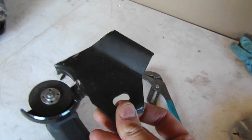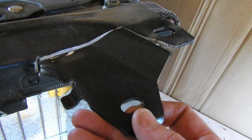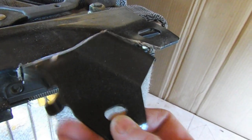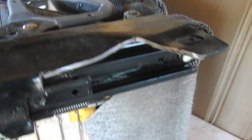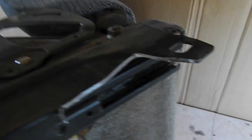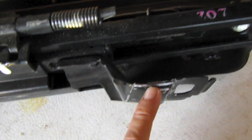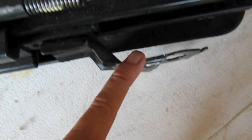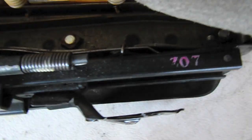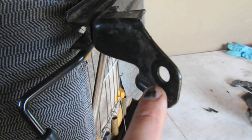Using an angle grinder, I ground off this bracket here. If we come over to the seat we can see where it came off. What I've done is bent this side up so it's a little more in line — a little straighter with the rail — because usually it bends downward at an angle. On the rear right side of the seat, I actually cut some of the bracketry and leveled it out so it's lined up a little straighter with the rail as well. That's going to allow the back end to sit pretty flush.